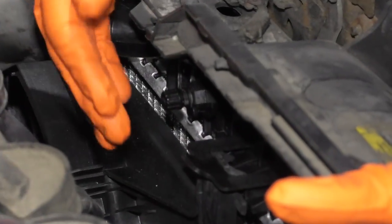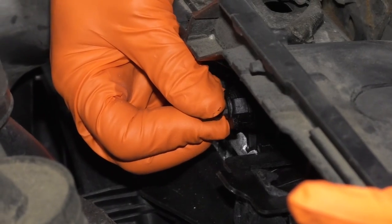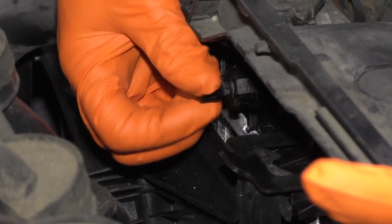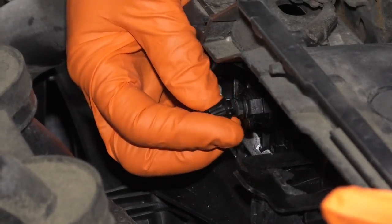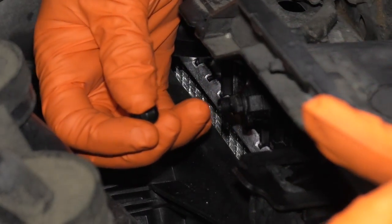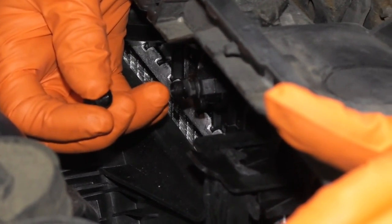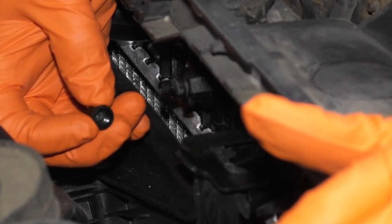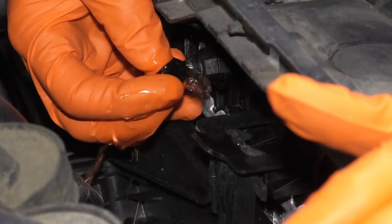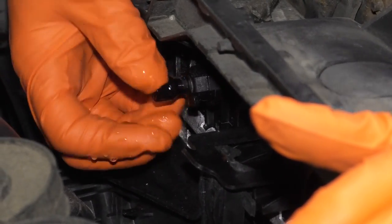So as you fill the overflow, or the actual radiator fill, you're going to take your vent cap and take the cap completely off. It's at the highest point, so the coolant will go down and push the air out. You can actually feel the air come out. Do that so you'll see coolant come out of here. There you go. You can hear air.